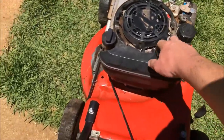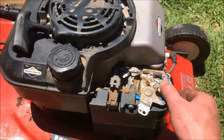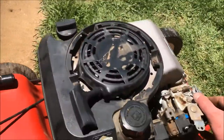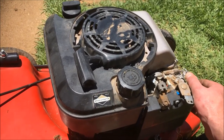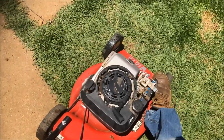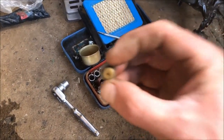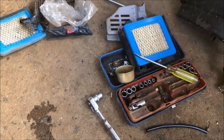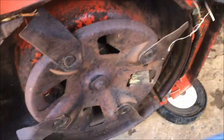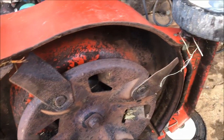Short cord. Okay, so I might need to pull the carb off and clean it. One more try. Well, maybe this needs a few goes — something's obviously not right though. I'm going to clean that off and try again. It's just got a bit of fuel flowing through the bowl. Blades are quite good. May replace the little friction washers that go under the bowl. Try again.